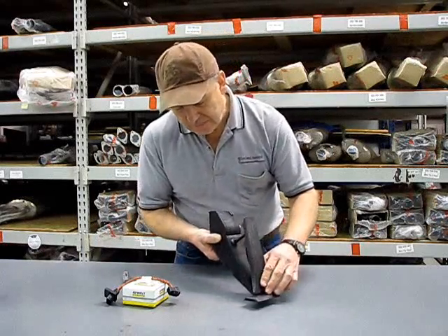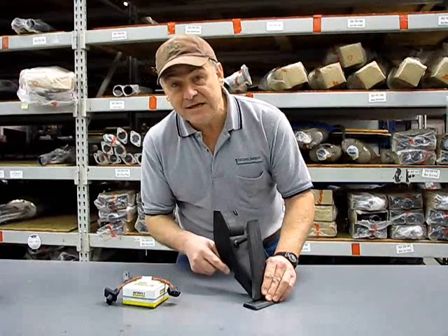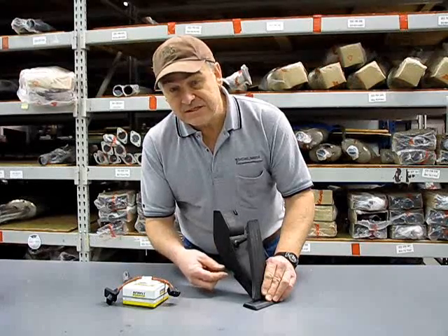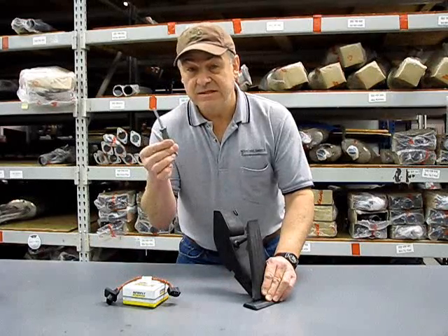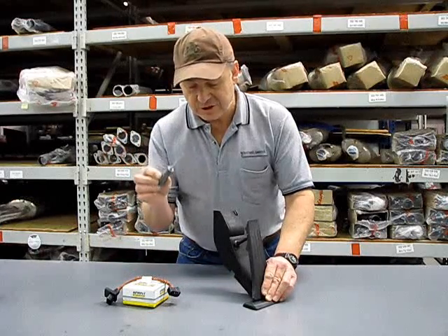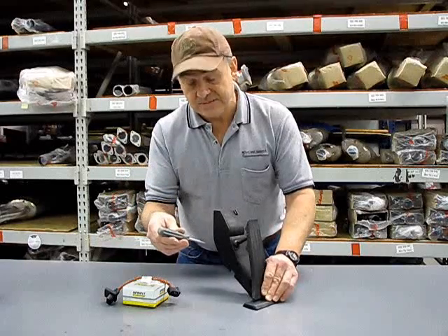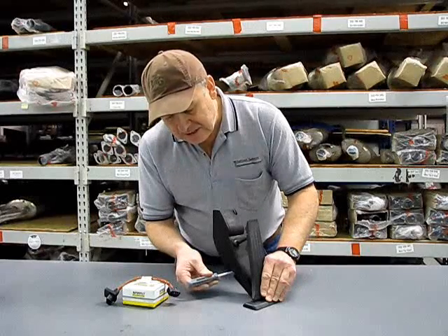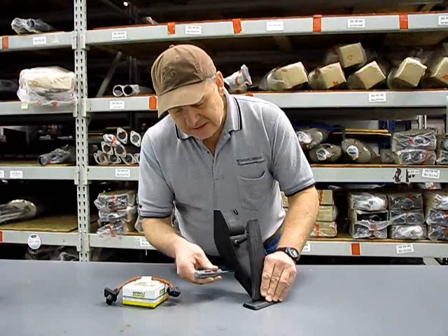You also have a small inspection hole right here at the side. If you look into that inspection hole on your car, you'll see a white plastic piece in there. What you're going to do is use the small BMW flat blade screwdriver that's in your tool kit — it fits right in between a couple of the little lock tabs. Put that right up against the top surface of the white piece and gently pry against it.